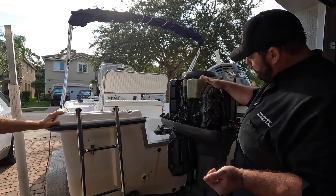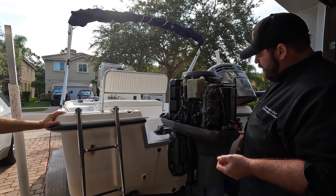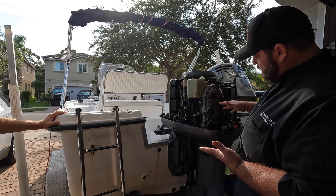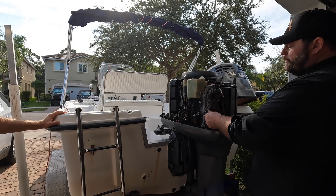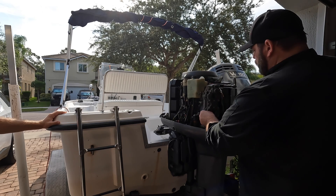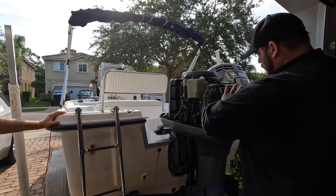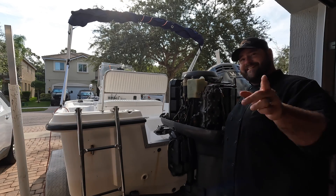What we're going to do is pull this water jacket and cylinder head off. I'm not even going to pull them apart separately - I'm going to rip off this cylinder head and then see if there's a hole in the head or a gasket break on the inside that allowed water to intrude into that bottom cylinder. These are 12 millimeter on a cylinder head and 10 millimeter on the water jacket. Let's get to it - check it out, like and subscribe to Chef Outdoors.